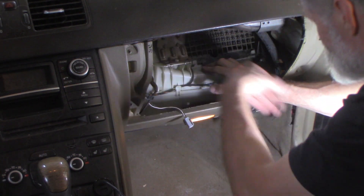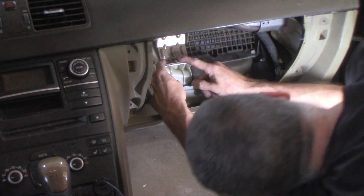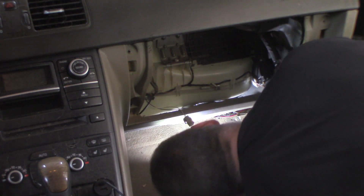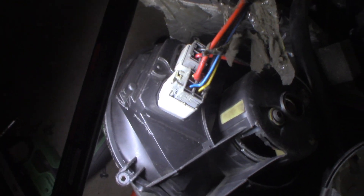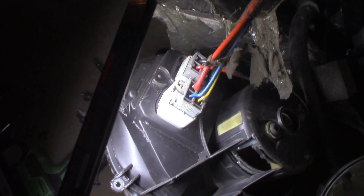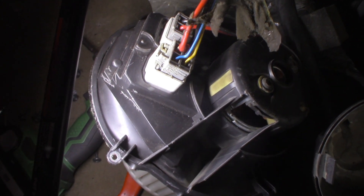I thought that would help me but I don't know if it's helping me at all right now. If I can get that below, then I can move that whole housing. There's the carnage - not too bad to get at actually. But this is the connector I was talking about earlier and you can see it's busted up - that was not me, it was like that. Somebody's pulled on this because you can see the red wire is pulled. The first thing I have to do is get that connector apart and test those wires - make sure we have power and ground.